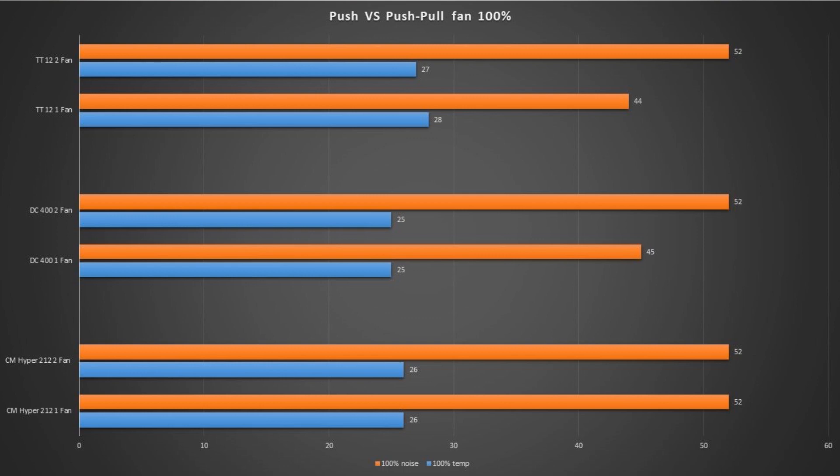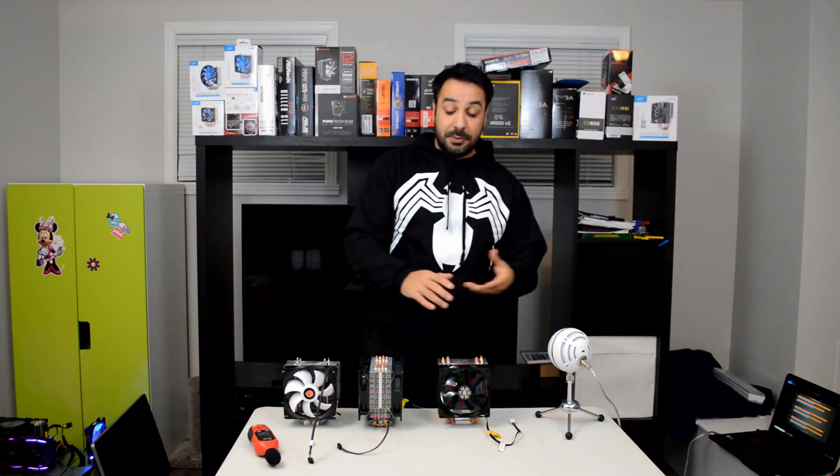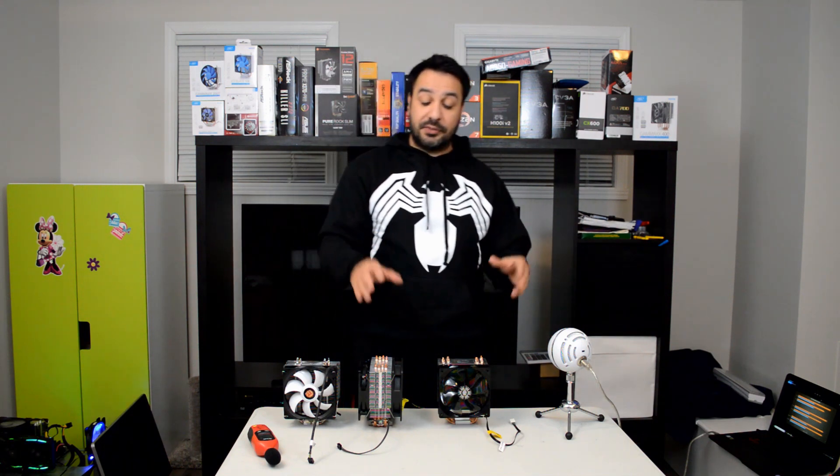It's not surprising that you can see the noise being at 52 decibels. The reason why is because the noisiest fan we were using was the Cooler Master fan that I attached as the second fan to each of the coolers, and it basically drowned out the sound from both the Thermaltake and the Gamax 400 — making it equivalent to the sound from the Cooler Master Hyper 212. That's why at 100% with two fans we're getting the same noise result from each. Of course you could use a less noisy fan, but at the same time you're not getting any performance uplift from adding it. So spinning fans at 100%, if you want maximum performance, it's unfortunately not worth it with these coolers to add a second fan.